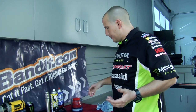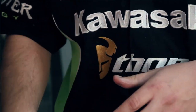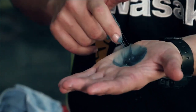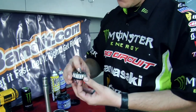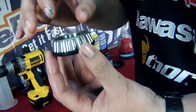A lot of people don't have bearing packers or don't have access to one. That's okay — we'll show you how to do it. Basically, same thing: grab your brand new bearing and get a big healthy palm full of grease. Kind of smooth it out and make it a little bit even. That lip right there is what you're going to be forcing the grease through until it comes out of the other side of the bearing.